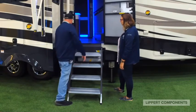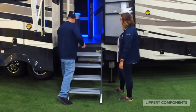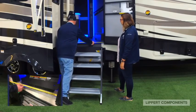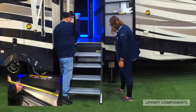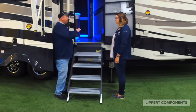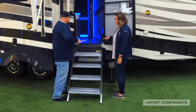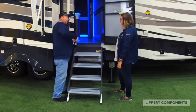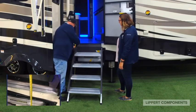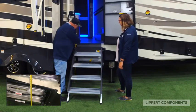The first thing you want to do is measure your door opening — the widest part of your door opening. This one is 29 and a quarter inches at the widest part of the door. Being 29 and a quarter, you would want to round up — you would want a 30-inch step. Always round up. Is that the only measurement we need? There's one more. You want to measure from the threshold down to the ground. That's going to tell us if you need a three or four step. This one's at about 42 inches, so this would be a four step.